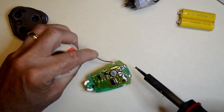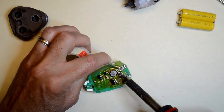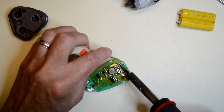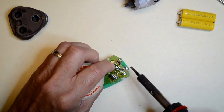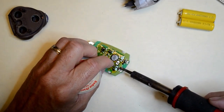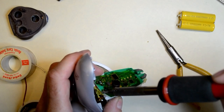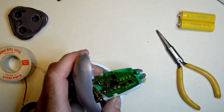After the battery holder is back in place, solder the battery leads. Now it's time to reattach the motor leads. Here, a third hand is helpful. I use a little plastic tub to keep the shaver from flopping over.